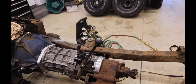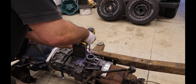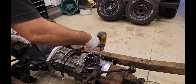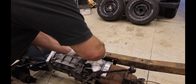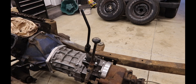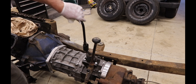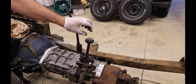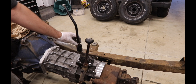That was terrifying. As luck would have it, I happen to have an extra AX15 shift tower, so I think I might have a solution. If I mount it backwards, I clear the interference. It might mean cutting more of a hole in the floor, but basically I just need to take this and bend it over this way - which I will do now. I'm going to take a cold rag and put it over here so I don't get that explosion effect again.